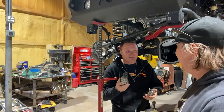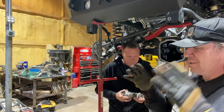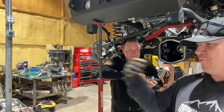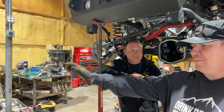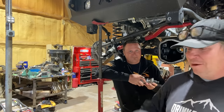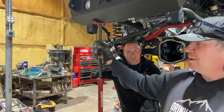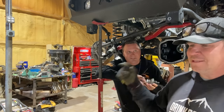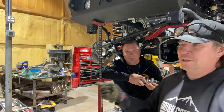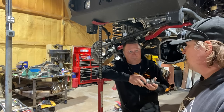You're probably going to get all kinds of funny comments because people are going to disagree with that, but that is the truth. So it's basically like even Motive Gear might have a 488 JT kit on the shelf from one run, and then a year later they ordered a new run and got another 488, but that doesn't mean you can take the earlier 488 and mix it. Just keep the ones together that are in the axle or that are in the box. Don't go mixing. If you break your ring, you can't just replace the ring. You have to replace the ring and the pinion.